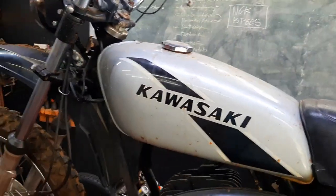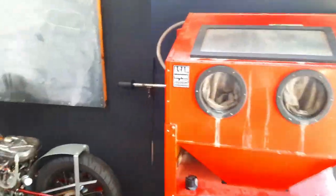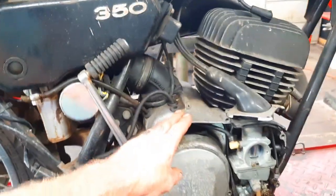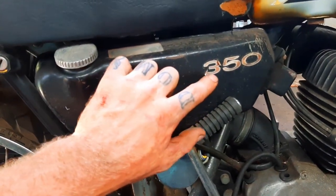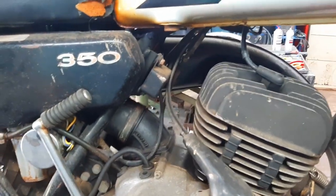The chrome on the wheels is great. I'm going to take the wheels, put them in my vapor blaster, and they'll come out looking like new. Same with the hubs — you can even put the shocks in there and it'll clean up the chrome perfectly. I'll do the chain adjusters, toss the side covers in the vapor blaster as well, and spray some new clear on the oil tank after gluing the decals down. I'll also clean up and repaint the pipe.